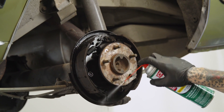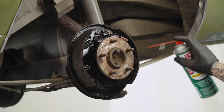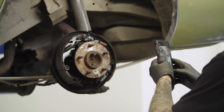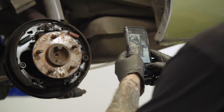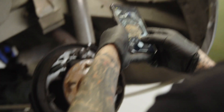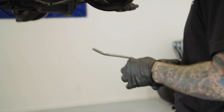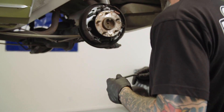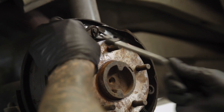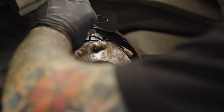I'm going to go ahead and get all this brake dust and stuff out of here, clean everything up. You can actually start seeing the color of the springs again. I'm taking pictures so I can come back later and reference how things go, because there are a lot of moving pieces in here — you can't take too many pictures. It's really a good idea to have a good set of brake drum tools. This one works really well, just to remove the springs. Be sure you don't drop any pieces.